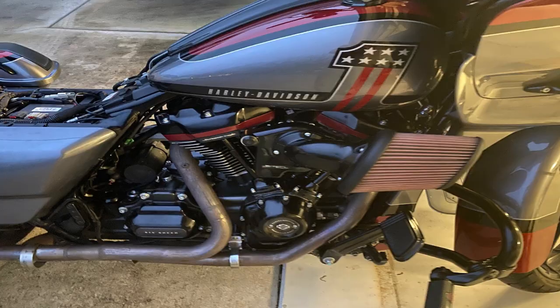Just like we talked about in the injector video, you can actually exceed the amount of fuel the injectors are going to provide. The same thing is true with air cleaners. The bright spot about air cleaners is that you can't overdo it, but at the same time you can definitely underdo it — and the bigger you build your bike, the more power you put into it, you can really start starving your bike for air.